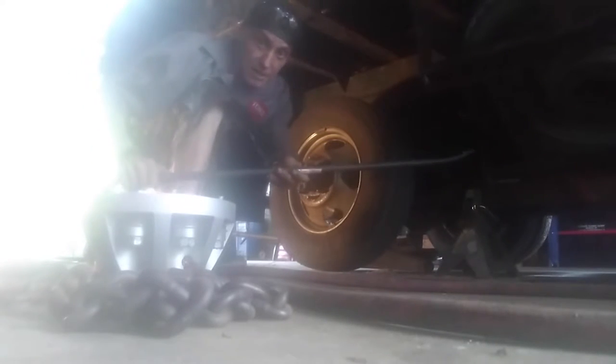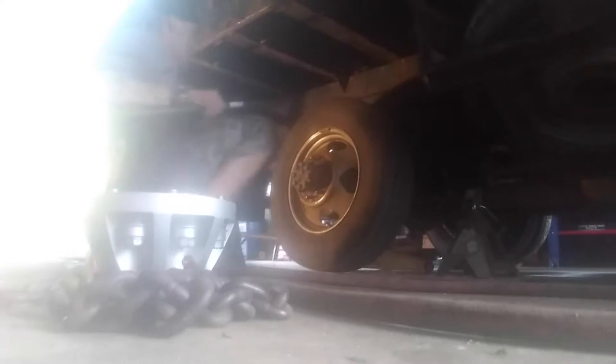Take the crowbar, stick it behind the wheel and try to pry. There's our rotor. Now before we get into anything else, you want to take this caliper off. The bolts you want to remove: there's one right at the top here, and then if you come all the way down to the bottom you're going to see the other one at the very bottom.